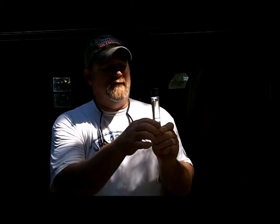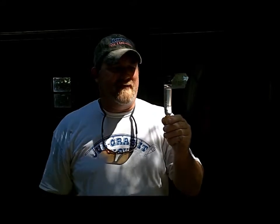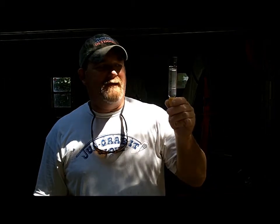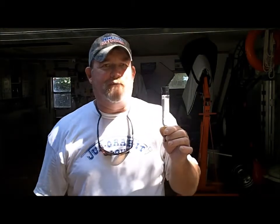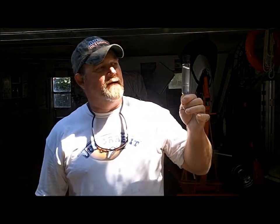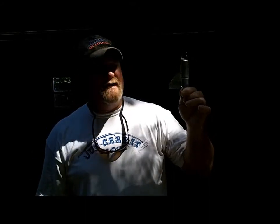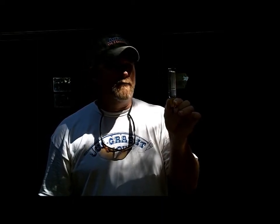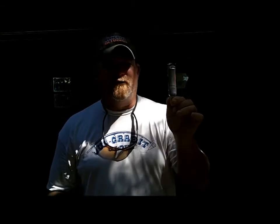If you go to the Mercury parts people — a Mercury dealer — they've got a little easier-to-read test tube and you can also see that on YouTube. This one's a little bit harder to read. Yeah, it comes with a fancy screwdriver thing on the bottom. I might get myself the Mercury one and keep one at home and keep one in my truck. What I'll do is let this sit for a day or two and just keep checking it to see if anything rises or falls. Falling I don't believe will happen; rising I believe could happen. So that's your ethanol testing.